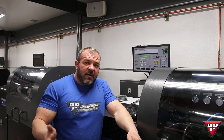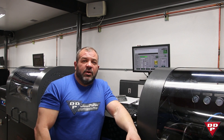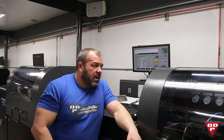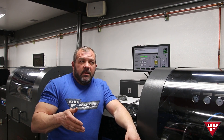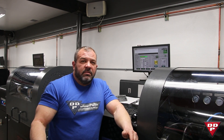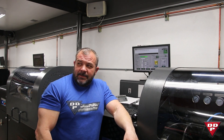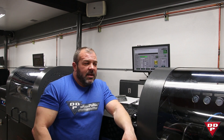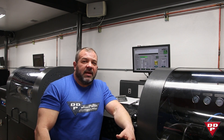You can increase the rail pressure if you modify. If you're using custom tuning, ask them what they recommend for a rail pressure sensor — I want to buy that from you. A lot of these tuners have those rail pressure sensors in stock. They can sell you one, rescale your tunes, give you some more rail pressure, and then give you a tune that's properly calibrated for it. If you want to make more power than what we just did on a stock injector, buy the proper size injector for the target horsepower you're trying to achieve. Don't buy something so big that it's out of control — buy the right size. We wanted to bring out some real life information and let you guys see what we deal with on a daily basis and the process behind what we're doing to go under your hood to make your truck do something that you actually enjoy.